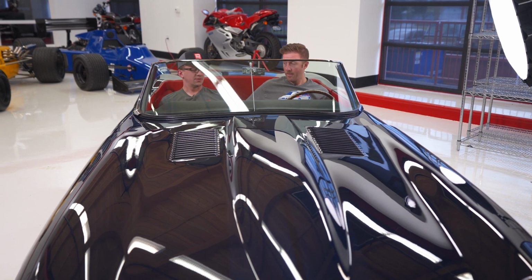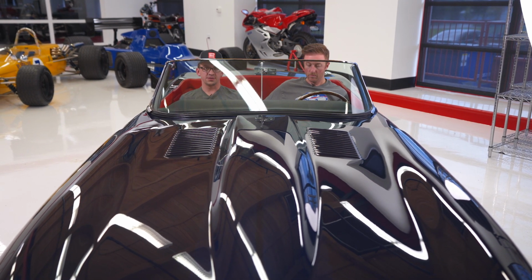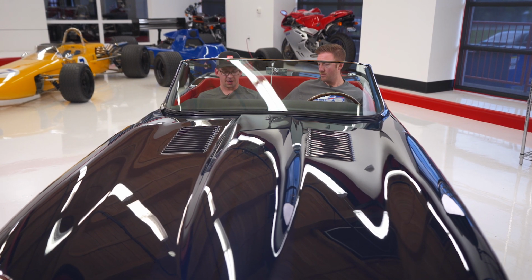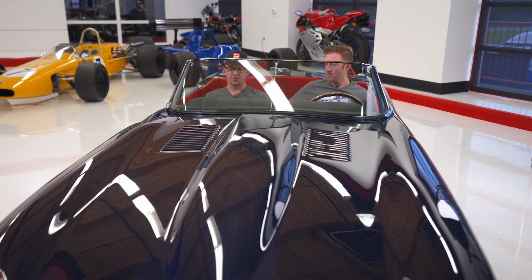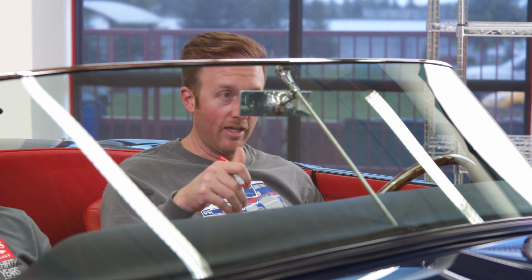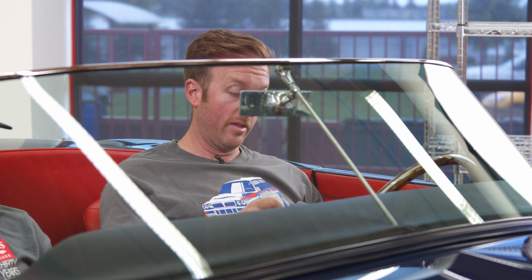Surface prep cleanser. We're looking probably at mid-June for launch of that. That's an alcohol-based, fast-flashing exterior cleaner to remove polishing oils, polishing residues, old waxes, sealants, polymers, silicone, whatever it may be on your paint or trim that you want to get off. It's an exceptional product. If you've got some texture, you might want to use an old toothbrush or a natural brush. Soft bristles. Don't go crazy with a nylon bristle brush. You don't need that much pressure, you just need the right cleaner. That should be available very shortly. I think I just got word yesterday that they had scheduled production. So that's a great one, coming soon.